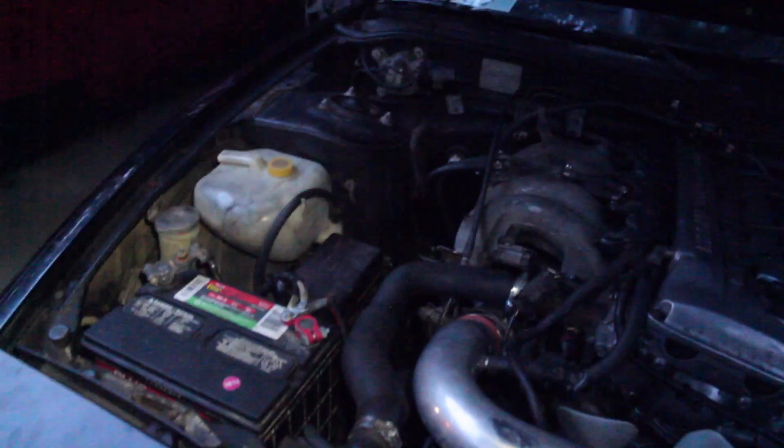The vert is inspected now. It was sketchy and overheating on the way home because of the traffic, so I put the clutch fan on. It's sketchy — I wasn't using one but there's one on there now. I'm going to re-bleed the coolant and we'll see how that goes.